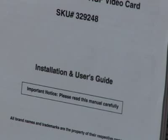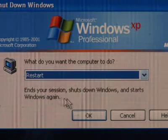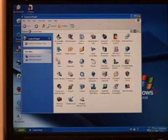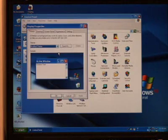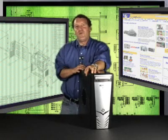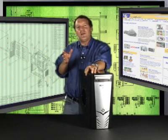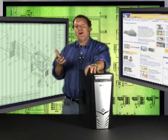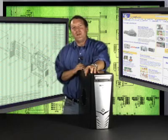Next, you'll need to install the drivers for the card. It should have come with a CD and instructions for how to do that. After rebooting again, you'll be able to see the card in all its glory. You can configure its settings using the display icon in the control panel. If you purchased the card to improve game performance, try it out in your new game. If you bought it for dual monitor support, attach your second monitor — you're going to see a huge boost in performance.